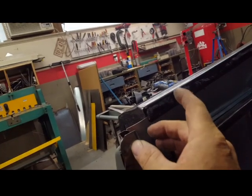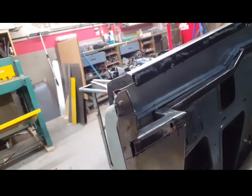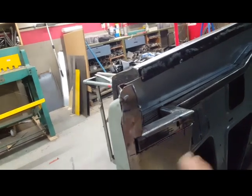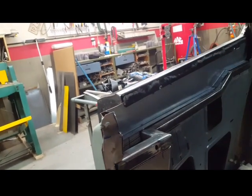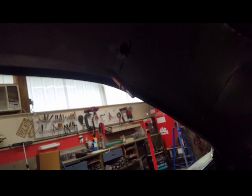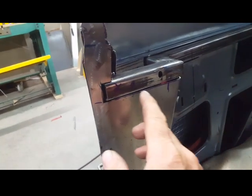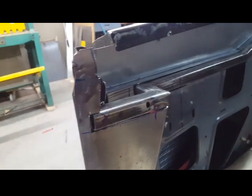This gives me an opportunity to bring a member down right behind the window molding and connect it to the roof. That'll help — these old cars used to flex quite a bit. When you jack it up the doors open up a little bit, but if you want to race it, this will help tie the roof into this structure. The bolt is embedded there and has a backer spacer so tightening it won't cave the sheet metal in. The option is there; I can always cover it with fabric if we decide not to use it.